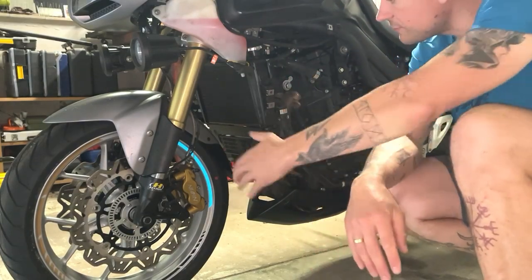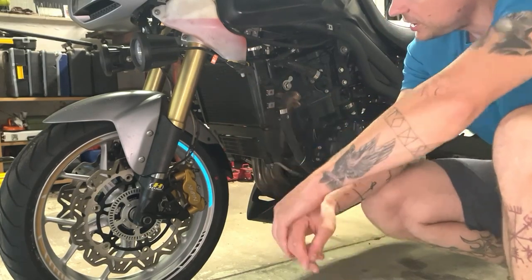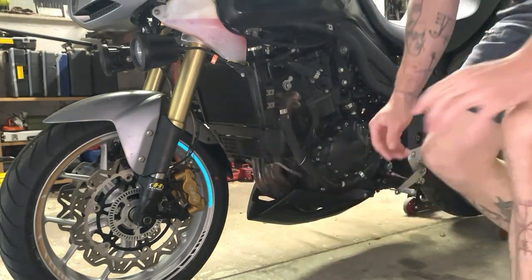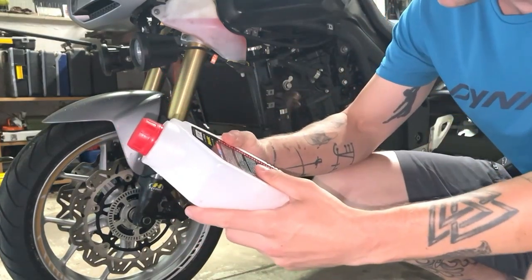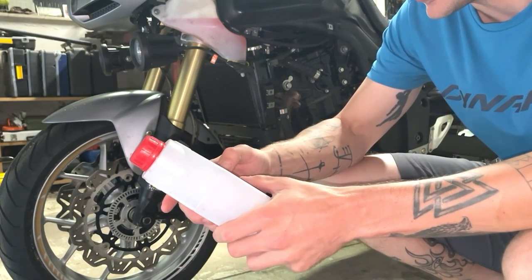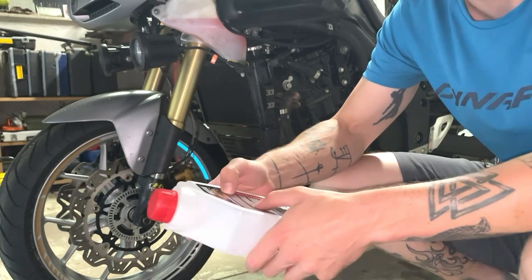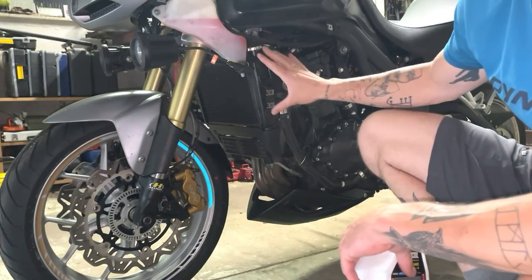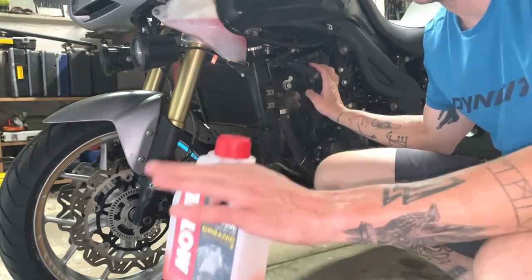And then of course we have ethylene glycol with water, a 50-50 mix, which gives water cooling. This ethylene glycol, like this one, basically goes from -35 to +136. This system has 1.1 bar, which means that the pressure is a little bit higher than the atmospheric one. The atmospheric pressure is 1 bar.